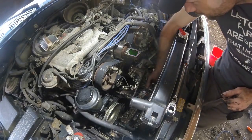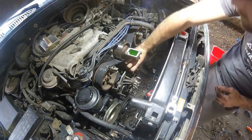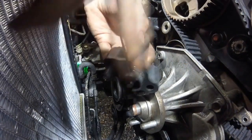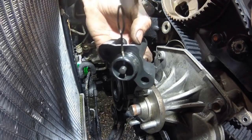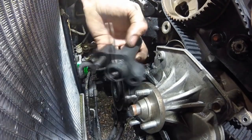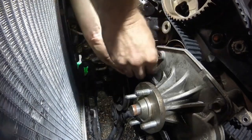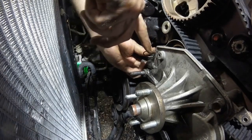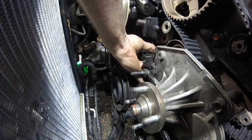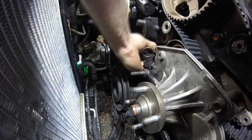Now that the belt's on, go ahead and slide the coupling on, tighten the bolts and the nut. Next step: take the new tensioner that's already compressed with the grenade pin — or your old tensioner if reusing it, already compressed with a grenade pin or some device to lock the rod back in the tensioner. We've got one bolt already in right here; slide it through the hole. The grenade pin is still sticking out in this opening on the fan bracket. Run these bolts as far in by hand as you can — you really don't want to cross-thread them. Tighten them down evenly, back and forth between the two bolts.